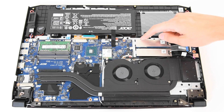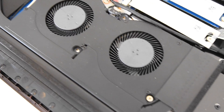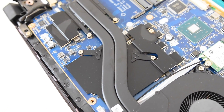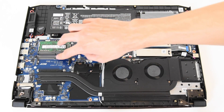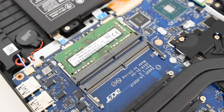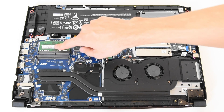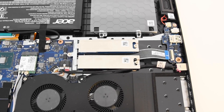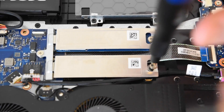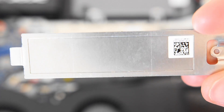In the bottom, we have the cooling system. Both of these fans do share two heat pipes, and this is considered kind of a bad design, because once the GPU gets too hot, it'll start overheating the CPU, which causes the thermal throttling. Here we have our two slots for RAM — we've got one 8GB stick. We'll start with the NVMe SSD drives. One thing I found really interesting is that they put on these little metallic heat sinks with a little heat pad, designed to keep your SSD cool and absorb some of its heat. I haven't really seen too many of these around, so that's kind of neat that Acer is willing to include that.